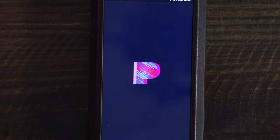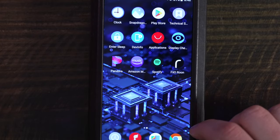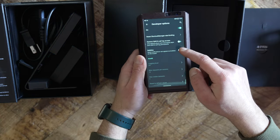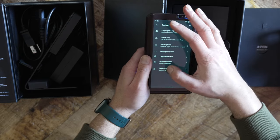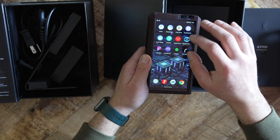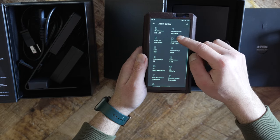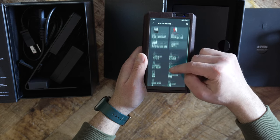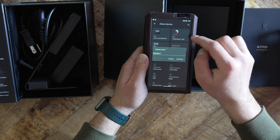In this section, we will briefly discuss importing music files onto the M17. The first and most obvious way of getting music onto the M17 is by having the SD card preloaded, but this presents an annoyance for some. FiiO typically uses a locked SD card slot, which requires an SD card pin to open. FiiO does include one in the box, but these items are easily lost because of their small size. Alternatively, you can connect the M17 through its blue USB-C port and transfer music onto the SD card. Windows should automatically see the M17 and its storage. Macs will need the Android file transfer software, which is free. FiiO's online FAQ says the USB can be used to connect to external hard drives; however, FiiO's manual does not mention this.